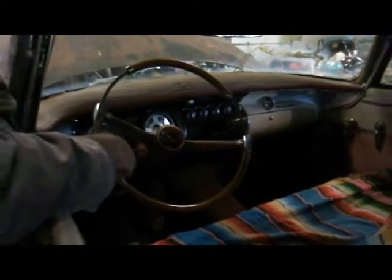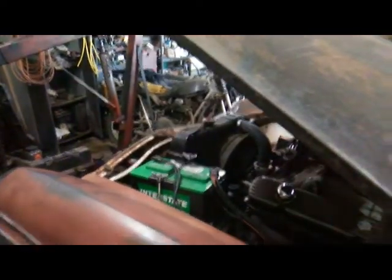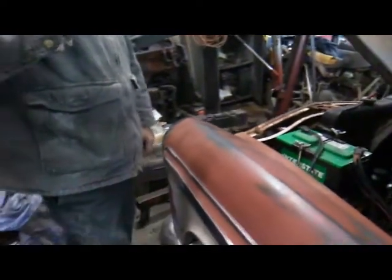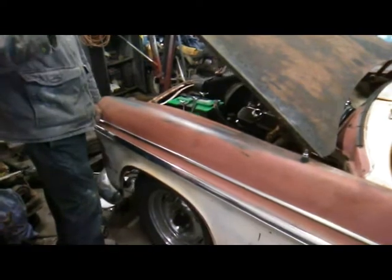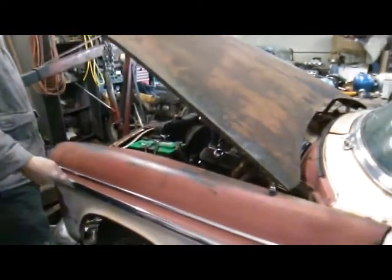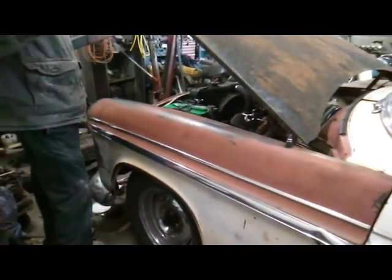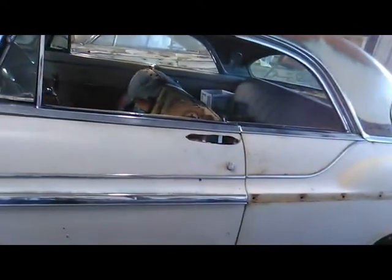Wow, cool. But this car, it's got a 1990 Chevy Cavalier rack and pinion steering setup on it, and Ford Granada disc brakes, and 80s model Dodge full-size van coil springs and shocks, which went right on there. I had to die grinder the lower A-arm just a hair to get the shocks to slide up through. And it's got 3-inch drop spindles on the front, and a 73 Charger rear end with 5-inch lowering blocks.